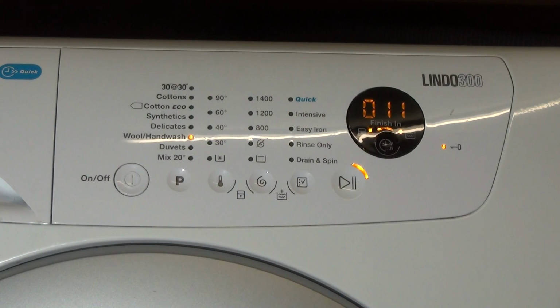6, if we notice, we've got 011, that's the temperature of the wash water. If you leave it on, it will steadily rise, and therefore you can test the heater. But it will take absolutely ages in this case. For some reason it's going down slightly, maybe it was 12 degrees before when I last tested this, so the cold water's dropped slightly. It doesn't immediately kick in, but it will start eventually.